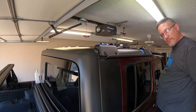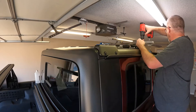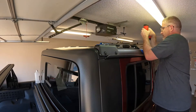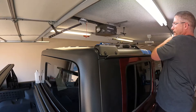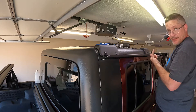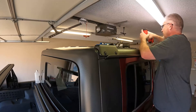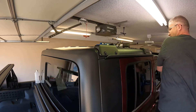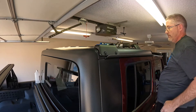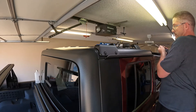Lots of fiberglass. Our quarter-inch pilot holes are drilled, now we're stepping up to a half-inch bit. I'll get the vacuum and clean this up. Now we're going to be drilling the pilot holes through the inside of the top, and I'm going to enlarge the pilot hole on the inside — the instructions say you can go right to the half-inch bit.